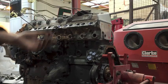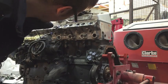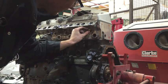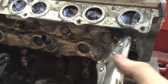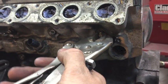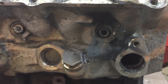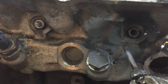So kindly someone's already snapped pretty much all of them for us. But yeah, we need to snap that off, and then we need to rip that head and the electrode clean out of the glow plug. The first one, we have just basically twisted the inside of the electrode with the mole grips, and then we can pull it out. It snaps off, and you're left with a hole. Now this hole is a very good thing because we can drill nice and accurately down there.